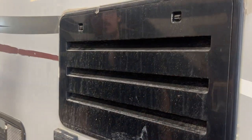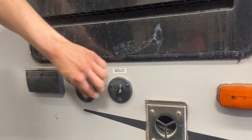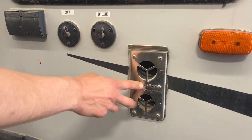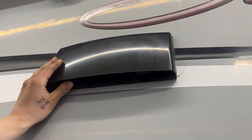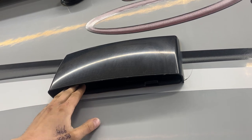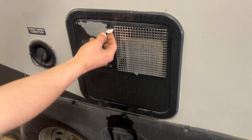At the door you have this little T-latch that slides in to hold it open. There's a service port for the fridge here — just service and a vent, nothing to worry about. Right down below you get a GFI-protected outlet as well as your cable and satellite outlets, so if you're looking to have TV outside, you've got the power to do so. Right here is the exhaust to your furnace — if you're running the furnace, make sure it's not blocked; it does get hot. Straight up from there you'll find your two exterior speakers and porch light right in between them, and your stove vent underneath. The propane stove puts off fumes when in use, so make sure the fan inside is turned on and this flap here is open to give fumes somewhere to go. Once you're done, press it into place — it'll click and prevent dust from kicking up during travel.